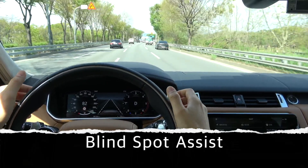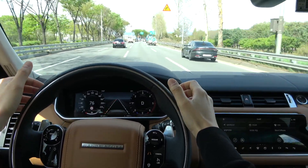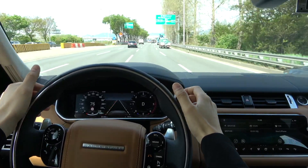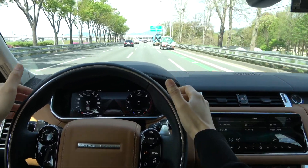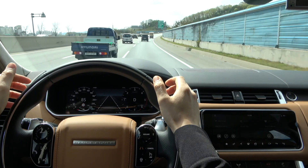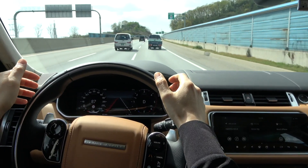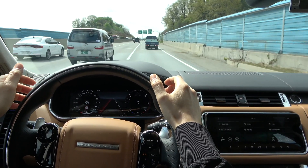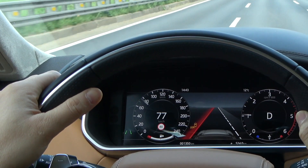This is Blind Spot Assist. Recall that Steering Assist was selected in the Blind Spot Assist setting in the instrument panel menu. Lane Keep Assist and Blind Spot Assist seem similar but are a little different. It is identified by an orange Blind Spot icon above the red lane in the instrument panel. The left lane of the instrument panel is displayed in red and the steering wheel actively moves to put the vehicle in the middle of the lane. If you see only the red lane, it is Lane Keep Assist. In Blind Spot Assist, the vehicle behaves the same but with an additional orange Blind Spot icon.